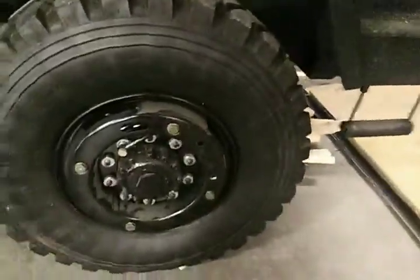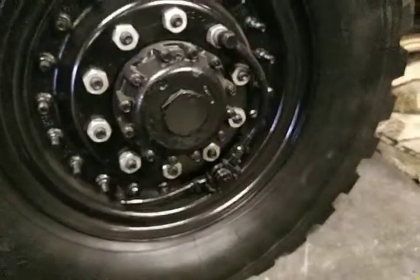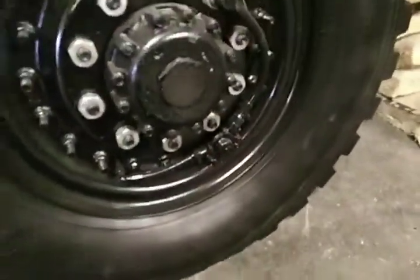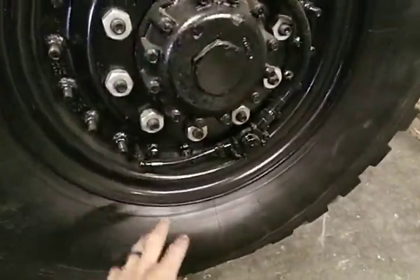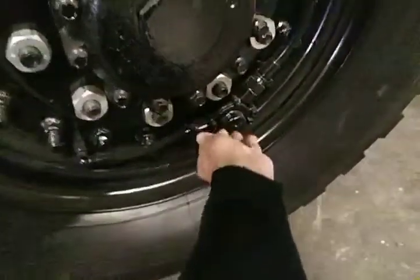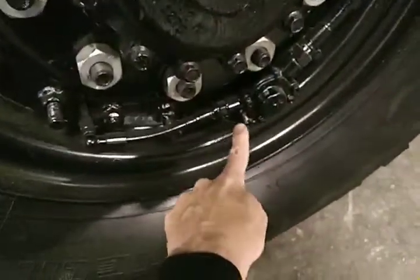We've got one mounted here right now. Let's take a walk back to the back of the truck. The CTIS system allows the truck for me to air up and inflate and deflate the tires as needed for the terrain. This is the hosing system here that fills the truck. The air travels through the axle, comes into this port here, goes through this little flapper valve and into the tires. If you knock one of these off or rip this little nub right here — which is just your normal everyday valve stem — you are out of luck. You're going to have a flat tire, you're done, you're not moving.